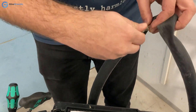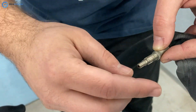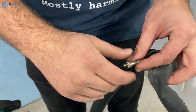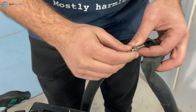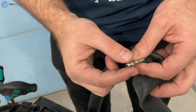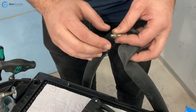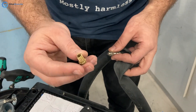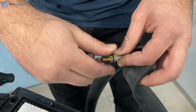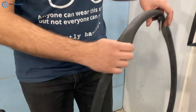To deflate a tire with this kind of valve you need to unscrew the top section — sometimes it gets unstuck partway, sometimes you need to unscrew it all the way and it flies out if you're not careful. Mounting pumps on this is also very impractical. It's best to use an adapter to screw on and then use a pump for the next valve type — that's the most reliable way of pumping these tires.